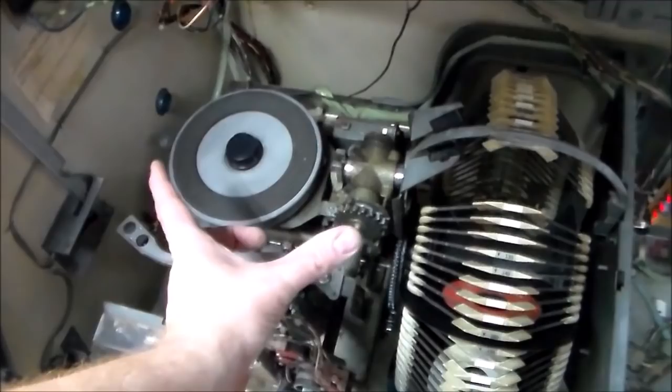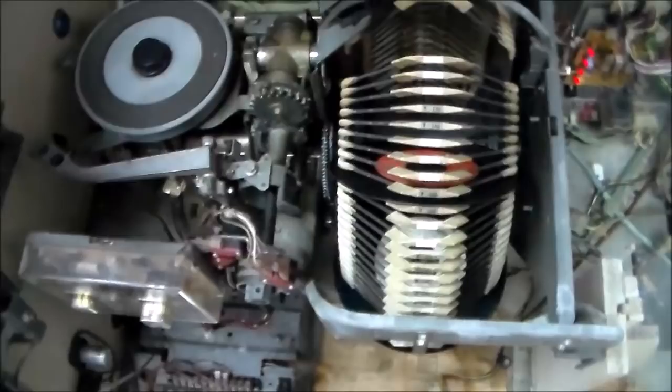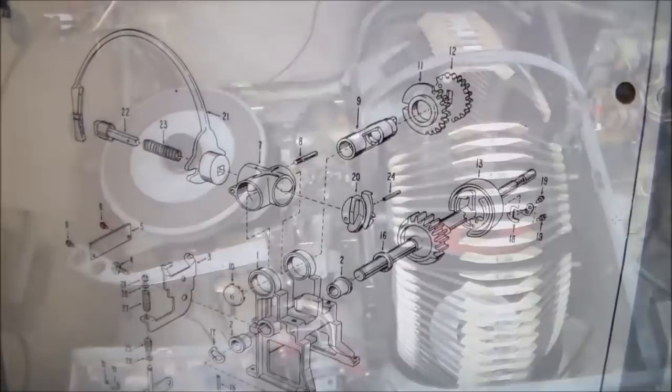And so as it turns, since this isn't loose enough, it'll kind of catch itself, and then it'll pull in above the record and not be able to grab the record. So if you've got that problem, if the thing stops every once in a while halfway up, or if it gets in a weird position, or it drops the record, it's almost always that you've got a bunch of gunk inside this thing. So I'll set up the tripod and we'll work through it a little bit.